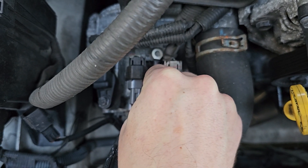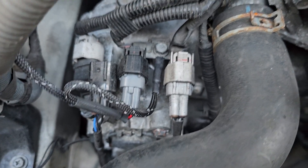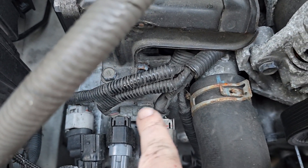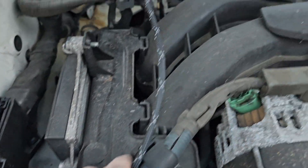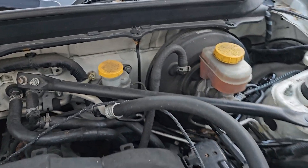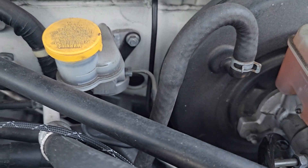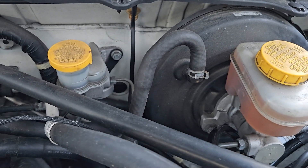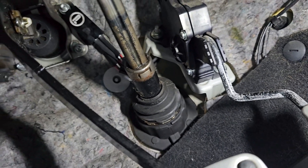You can arrange the wire however you want — it looks clean. That's how I have it before I've zip tied anything out of the way. Back there next to the clutch fluid reservoir underneath is a grommet, and that's what you're going to use to feed the wire through. You just basically cut an X with an exacto knife or a razor blade.